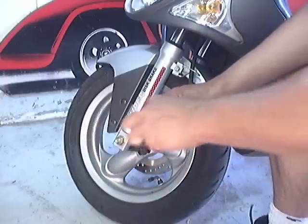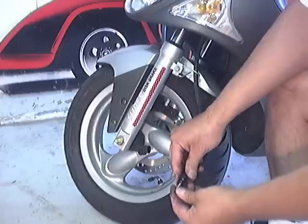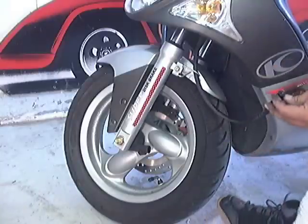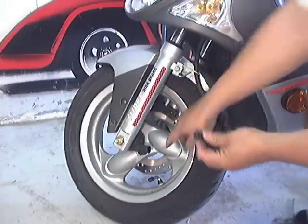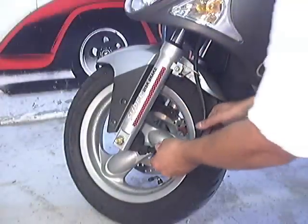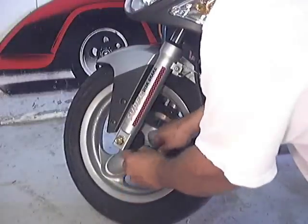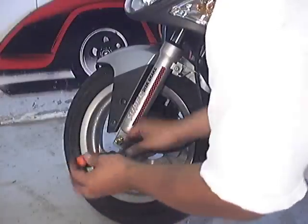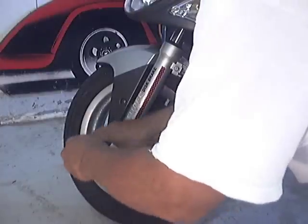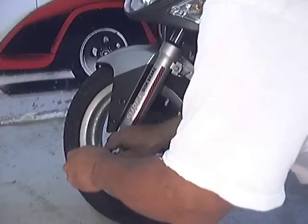It's kind of odd that it's short for this one too — I don't know what's going on with that. If it doesn't go all the way in, just twist it a little bit. You'll see this little groove here — it has to line up with a little groove inside. You might need to turn the tire or something to get it to go all the way in. It's in. I'll reassemble this and take it apart up on the top behind the instrument panel to see if it came loose up there.